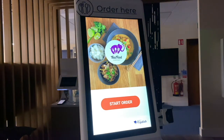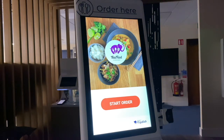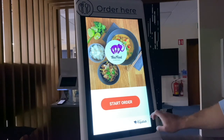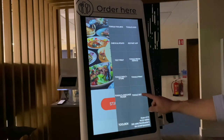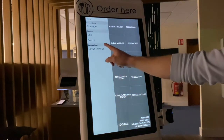Now let's set up the card reader and connect it to the kiosk. There are two ways to connect the card reader. First, using the toggle settings on the device itself — this is useful if you don't have access to the FlipDish portal or if the card reader has disconnected and needs to be quickly reconnected. Press and hold the FlipDish logo in the bottom right-hand corner of the kiosk screen for five seconds until the logo turns black. Then swipe from the right-hand side to the center of the kiosk and a menu will appear. Select Toggle Settings, which is the option in the bottom right-hand corner of the menu.